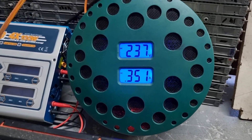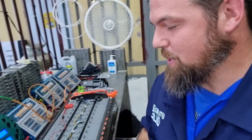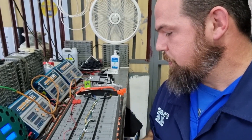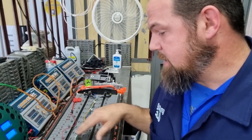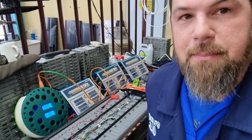Good morning to everybody. This battery is fully in balance right now. Welcome to this new episode. We're just continuing the servicing of the high voltage battery from the 2017 Toyota C-HR, as well as the same fourth-generation Toyota Prius Eco. It's been over 24 hours — it's about 237 volts divided by 28, giving us about 8.46 volts per module. So we can say that this battery is fully in balance right now.